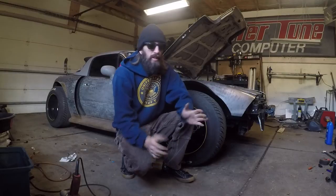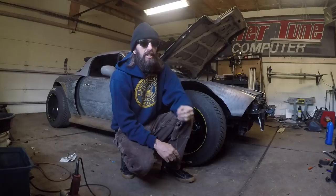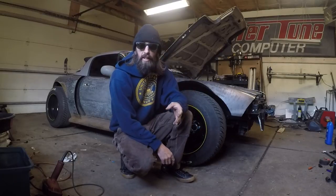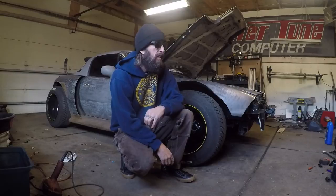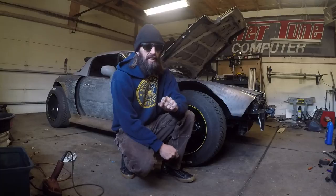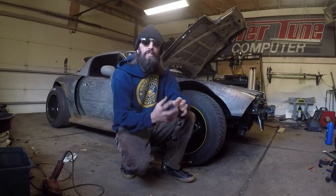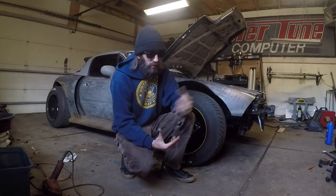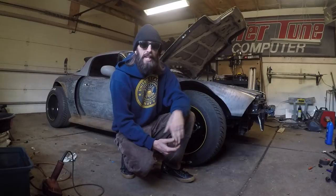So clearly that works. So we shouldn't have any more smoke coming out from the engine bay. We also shouldn't have any clutch slip, which is a bonus with these big tires. If you have oil all over the back of your motor, firewall, exhaust, it's probably your cam angle sensor. It may very well be your valve cover gasket as well. So check for oil before you do this. If you see oil anywhere other than the back around the valve cover, do the valve cover gasket as well. I think it's like $27. Most parts stores have them in stock, or they can get them next day. Maybe adds another 20 minutes, 30 minutes tops to this job.